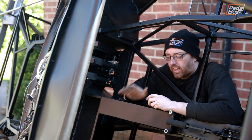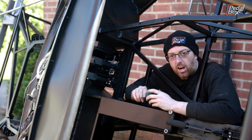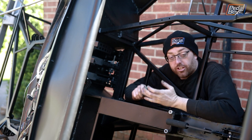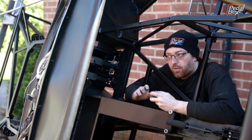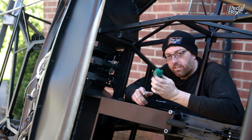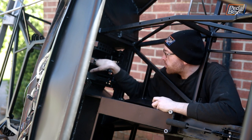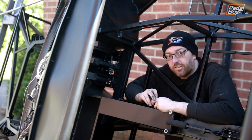With the car going back together we're going to have to deal with the last few bits of wiring that we left undone before because they were just too head-scratchingly difficult to deal with. One of them is the brake switch — this has four pins on the back that go into a little plug, and that obviously controls the brake light, but it's also a trigger for the cruise control in the ECU. Now we haven't got cruise control but we might want it in the future, and we can retrofit the stalk and everything else, so having the wiring is very useful. But actuating this, which is just under 15mm of travel in the switch, from a pedal that has absolutely no space behind it and ultimately has a lot more travel than that at the very top, is kind of difficult to work out.